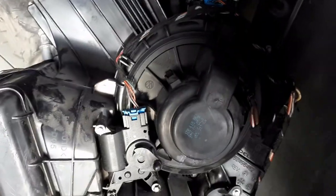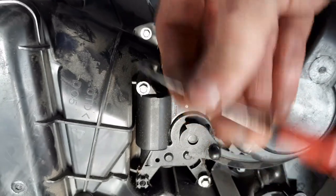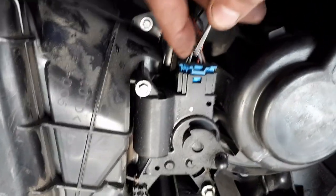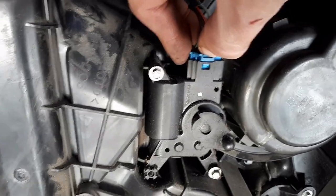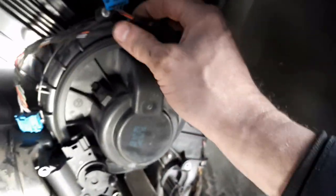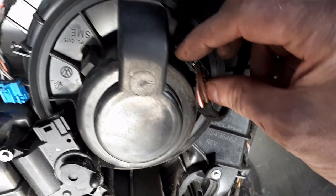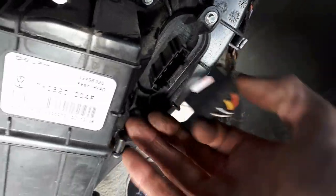The final task is just to remove the electrical connectors — they've all got a security catch. I'm using a small screwdriver to pull the tab back. It's a lot easier when you're not holding a phone in one hand. Pull it out. There's another one at the top — I pulled that out already. There's one at the top here where you have to pull two prongs together. Same down here. Just disconnect the wires all the way around and pull them free from the clips.